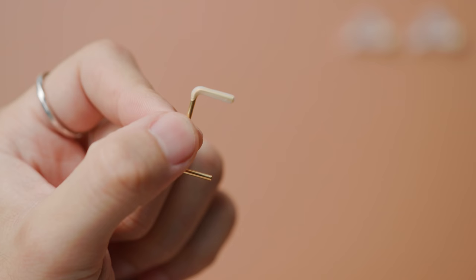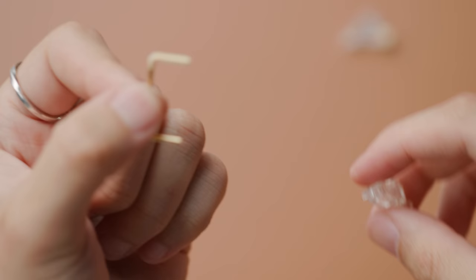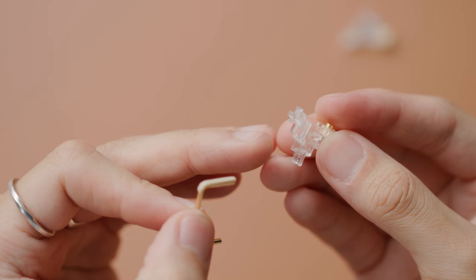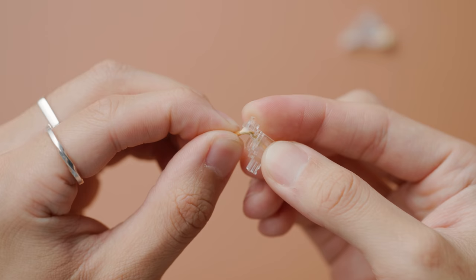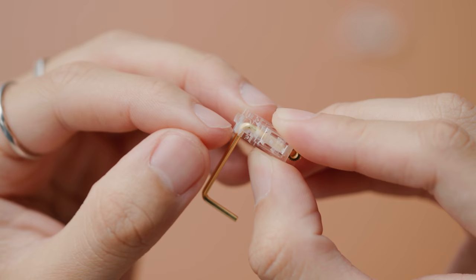At this point, you should have lubed just one end of the wire. While holding the middle of the wire in one hand, pick up one of the assembled stabilizer housings with your other hand such that the stem points downwards and the edge with the gap is facing towards the wire. Simply insert the lubed wire into the topmost hole from this view, then turn the stabilizer housing 90 degrees while slotting the wire into place — you should feel it click into position. Remember to lube past the angled bend, as you also want a little bit of lube on the area where the wire bend is held onto by the plastic. We've now basically lubed all the points of friction. Repeat the process for the other half as well as the remaining stabilizers, and ensure that after installing both stabilizer housings back onto the wire, they are facing the same direction.